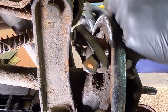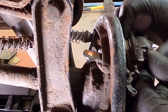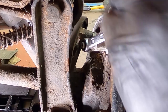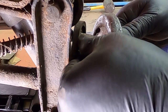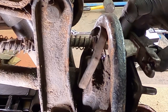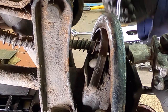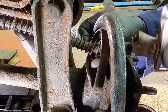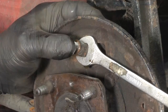Once these two pieces are removed I'm going to pull the assembly through the back plate. I'm going to remove the handbrake lever and slacken off the bleed nipple. Removed it — pull the whole assembly through the back plate and now we can put the spanner back on the brake hose and twist off the wheel cylinder. Note you'll get a bit of brake fluid leakage. We've now removed the wheel cylinder.